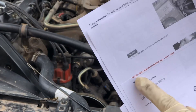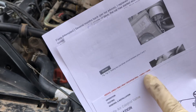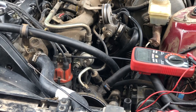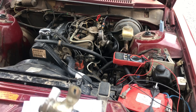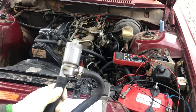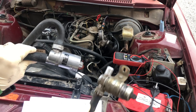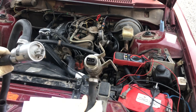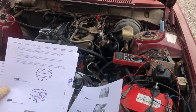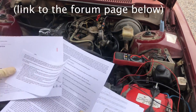If you look carefully at the top of the paper, it says Volvo 240, 740, 760, 780, 940, 960 — 1990 to 1998. That's all LH 2.4 stuff, but this is not an LH 2.4 idle air control motor. This is an LH 2.2 motor; it goes straight through. The LH 2.4 motor — everything 1989 and onward — has two pins and an angled outlet versus straight-through plumbing. So why don't we just scrap these AutoZone instructions and go straight to the forums.